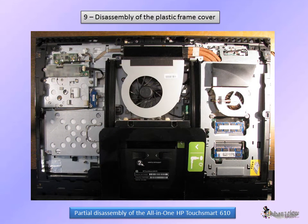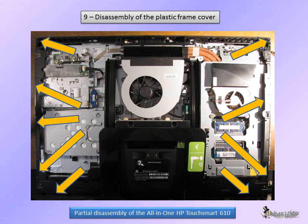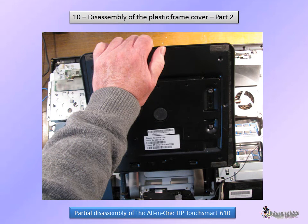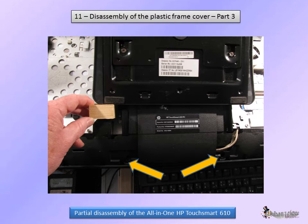Let's get further in the disassembly. You need now to extract the frame cover. Start by removing the nine screws pointed by these arrows. There are two screws left — you'll need to put the base out of the way. Just slide the base all the way up. You'll need to apply strength to do this, so you'll need to hold the top of the screen with the other hand. Once the base is in position, you can use something to prevent it from sliding back — I used a piece of wood. A too soft object will not work. Then you may remove the two screws pointed here.